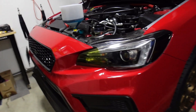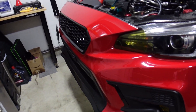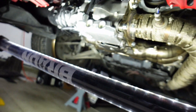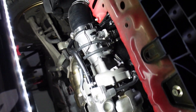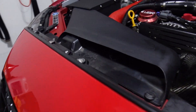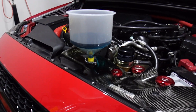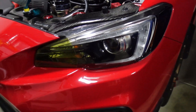It's actually a couple days later — it is January 1st, happy new year everybody. I finished installing everything on the car; it's basically ready to start. Before that I need to prime the system by cranking it and making sure it doesn't start. You can do clutch plus gas and then ignition to flood the system, because we want oil running to the turbo. Also right here is a coolant bleeder kit — since we took out the turbo we introduced air into the coolant system and we need to get those air bubbles out.